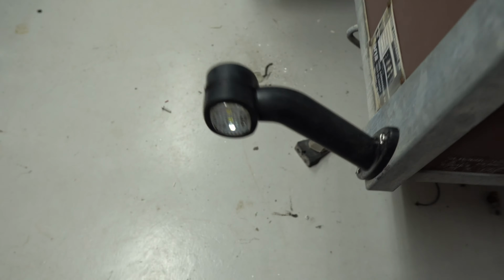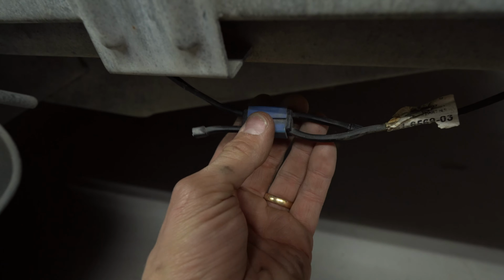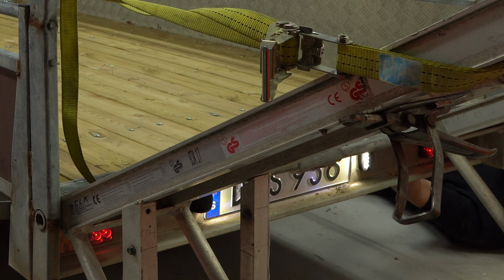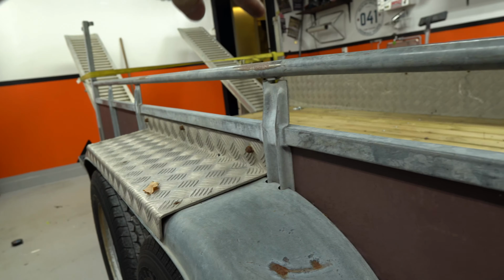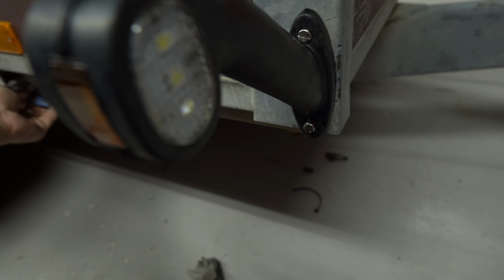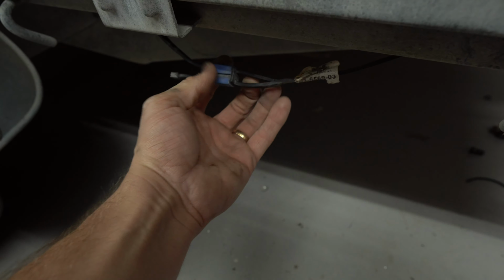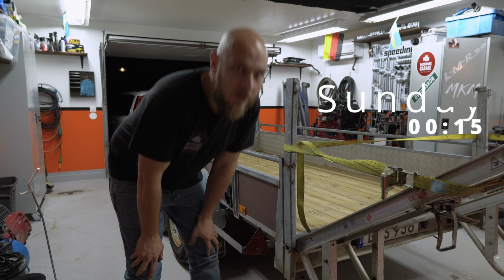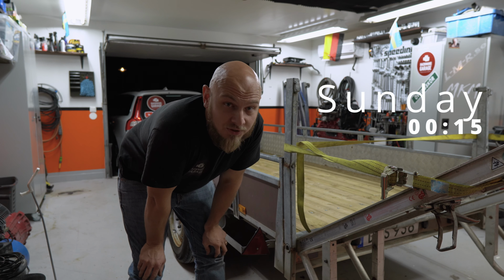This is not lighting up, and it is because of these. They are located here and there along the chassis. I have swapped out three of them now, because the license plate on that side was blinking, so I swapped that one out earlier, did that side, so this is the only one left. And when I touch it, you can see it's just letting through a little bit. So I'm gonna go ahead and solder this straight together and get rid of this thing, and hopefully that'll solve our problems.